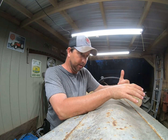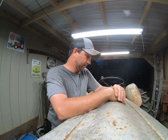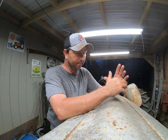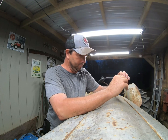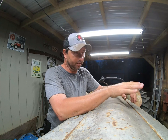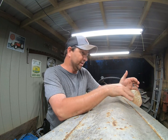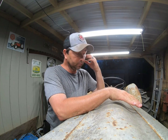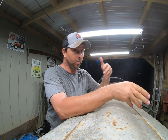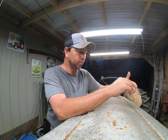You're going to have a charging circuit, a starting circuit, and an ignition circuit. For the charging circuit, if you're doing a 12-volt conversion, I highly recommend using what they call a GM one-wire alternator — it's not really one wire, I'll show you in a second — but it greatly simplifies things. It literally is one wire that goes back to charge, though there are two wires involved minimum.